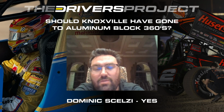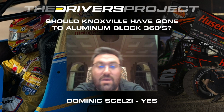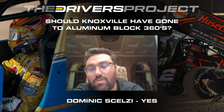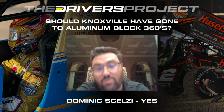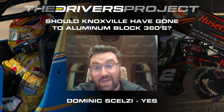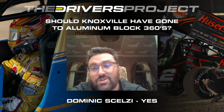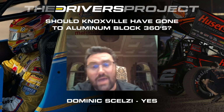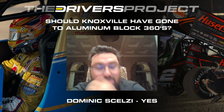We had to weld on it a little bit the first time, and it was repairable. We didn't have to worry about lightening it. From my steel 360 that we had to lighten, compared to my aluminum block not having to be lightened, it was about a $1,200 difference. So we saved $1,200 with an aluminum block compared to the steel block being fully lightened. So I like that. I will say it doesn't run as good. There's no question about that. I feel like my steel stuff definitely runs better than my aluminum 360, and it's shown that, even on the dyno.